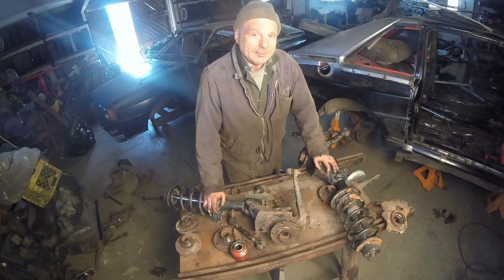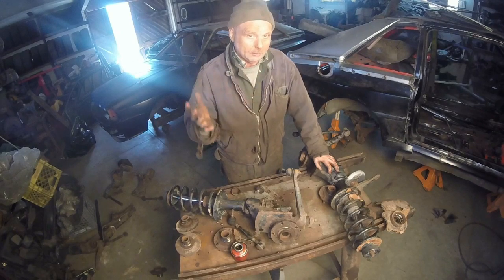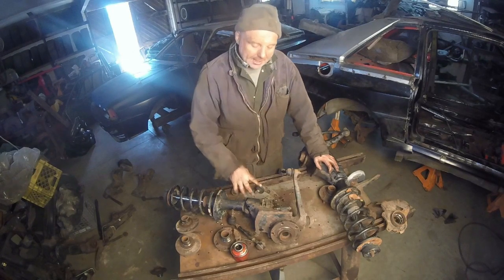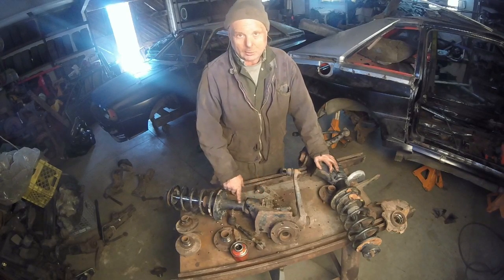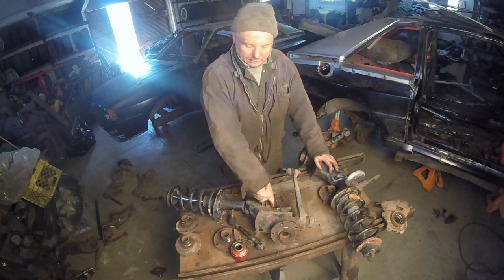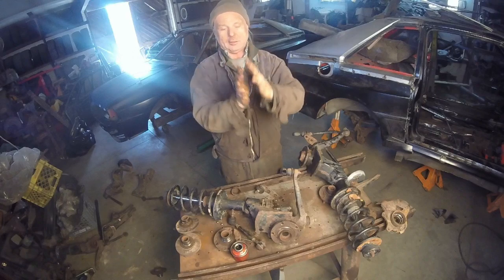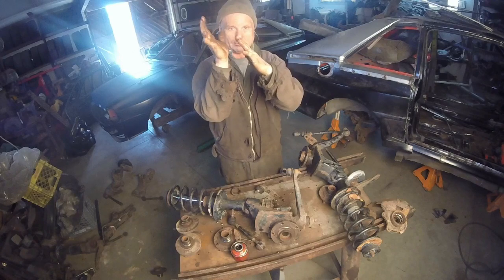Second thing, when we have the control arm extended out, we can't move the top of the struts out to keep the same camber or to have that adjustability in camber. What we have to do is cut this strut, and it'll be angled, don't get me wrong, a little bit, but that won't be for now. We're going to do that later. I don't care if it's angled like this on the floor, but when I cut it here, because all this is sheet metal and weld it onto the strut tube, I'm just going to cut it and open it up just to bring out, because it's going to be sitting like this right here. I'm going to keep it like that, make a slice, bring it out.